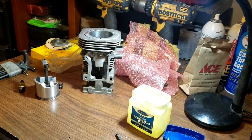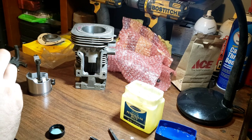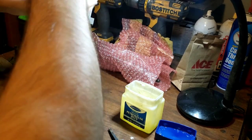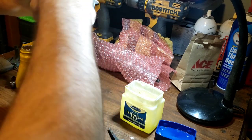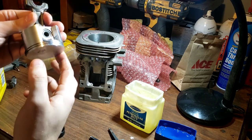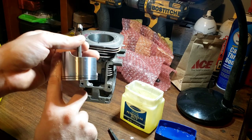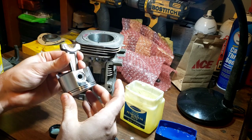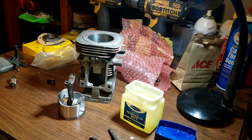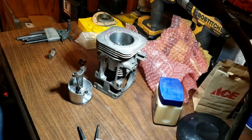All right, who's ready to watch me struggle? First thing: lube up your bore. Don't put stuff in dry — bad, bad, bad. Two-stroke oil works for any two-stroke, probably any oil actually. These rings are pinned. Brand new piston — Terry said he had one on the shelf and would send it. All greased up and good. Hands cleaned off.